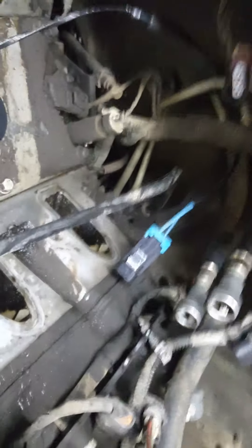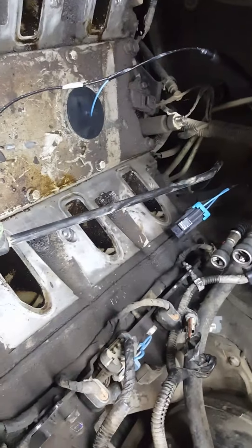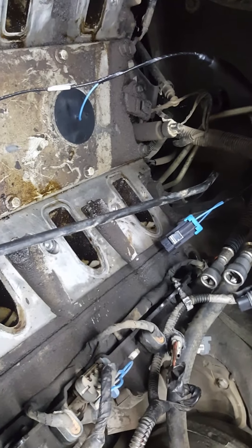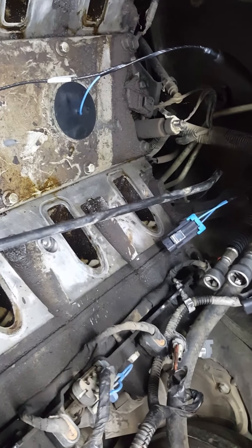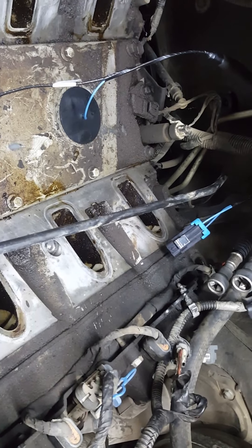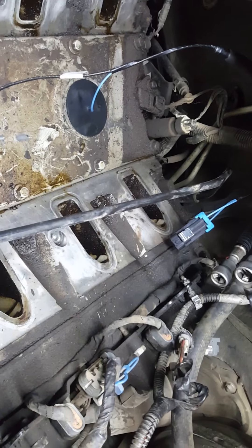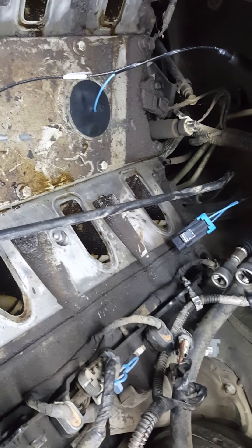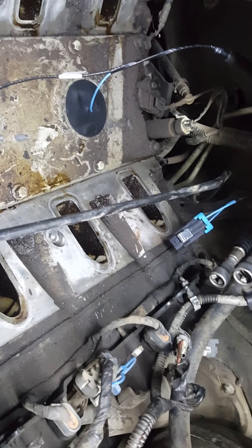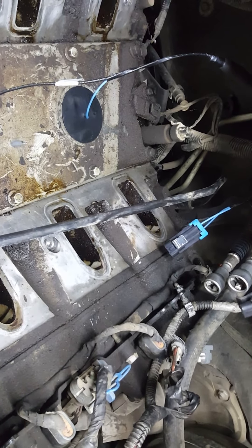With the O'Reilly sensors, these were ohming out at 104 ohms. I'm going to test these to confirm they're within spec — the spec said 99 to 107 ohms. But my factory ones on my service truck's 6-liter were 99 to 100, and these aftermarket ones were up at 102 to 104, so they were already on the high side.